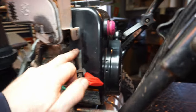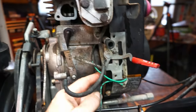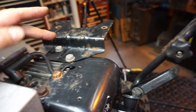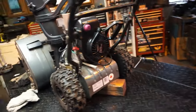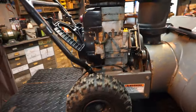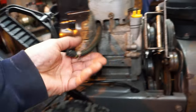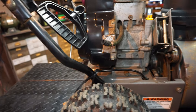To get the cover off, you shouldn't have to take this off — it should be mounted to this piece here, so leave that on. We've got a bolt down here, a bolt on the other side, and unfortunately we've got these bolts and you've got to at least take this bracket off. I know it sucks, but that's how these Tecumsehs are. We've also got a little one up here, and it'd be a good time to change out the hose.